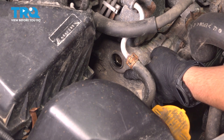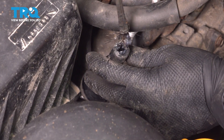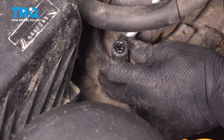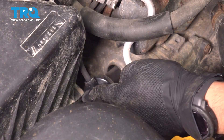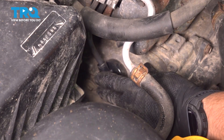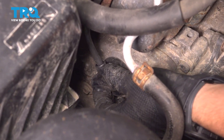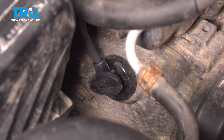On the end of the spark plug wire, I like to put just a little bit of silicone paste on the edges. This is going to prevent the spark plug from getting stuck on the wire and will make it seal up nice. Now put the spark plug wire back into its spark plug hole. Press it on nice and tight — make sure it locks in there. You should feel kind of like a soft click at the end, and pulling on it gently it should not want to pop out. This one's done. Let's continue on with the rest.